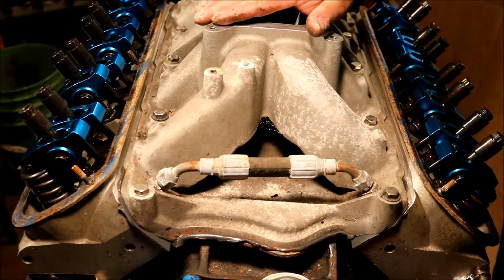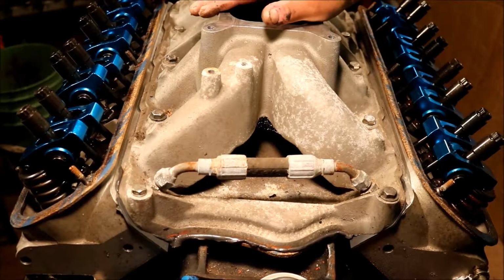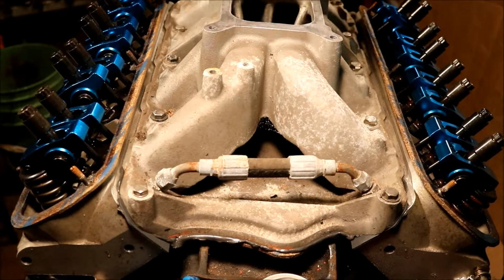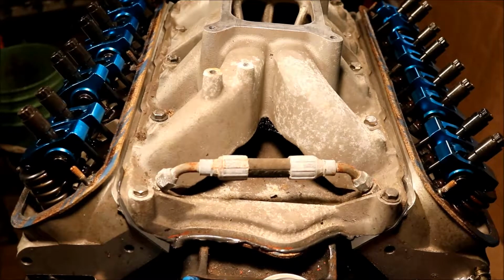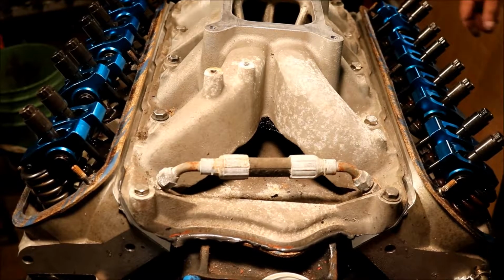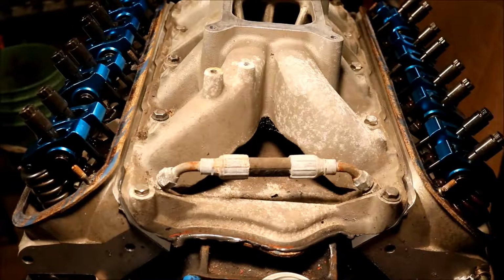But this right here is a good example of a pick-up-on-the-side, bracket racing motor. We'll see when it starts up, but so far this is a good example. I'm going to chip it for 6,200 and shift it at about 5,200. It's going to slow my car down a little bit probably, but we won't know for sure till we put it in.